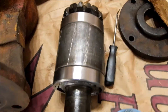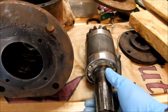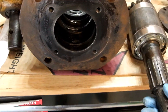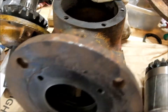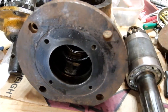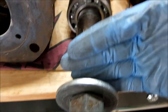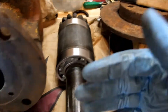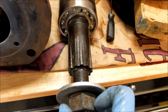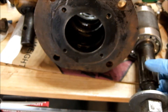This whole assembly is just a sleeve — a simple shaft. There are two clips in here, but the hard part is getting this shaft out because you need to pull on it. Sliding hammer? Sure — but let's go with no tools necessary. Get blocks of wood on either side to pull this shaft out. I used two-by-fours on either side with a nut and some washers — or you could use a brake rotor that fits. Just a plate, a two-by-four on either side; tighten it down and it pulls the shaft right out.